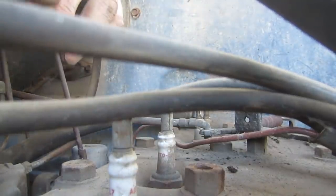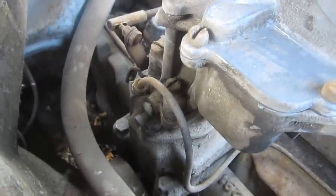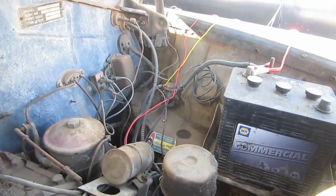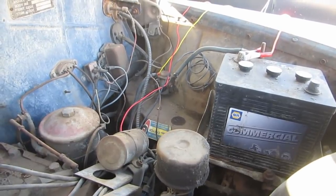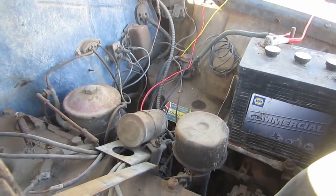Okay, choke, same deal. Vacuum to wipers, shouldn't matter. This guy we're going to hook up, and I'm going to block off the vacuum advance of the distributor because the diaphragm is compromised and it'll leak. So let's hook this up, and then we'll get things a little closer. I've got my rig from the Buick Packard setup, so we're gonna bypass the original wiring and start it on 12 volts just so that we have a chance of getting it cranking over. And then once it's warmed up, it could probably go back to the 6-volt system, just hook up the couple wires, and I may even take the ignition apart and key it to fit one of my existing keys.